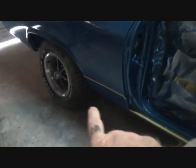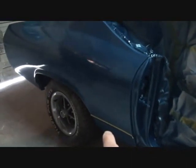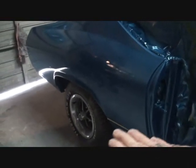Now that we got the car painted we went ahead and pulled some of the parts in here. We've got the fenders, the doors, and the cowl paneling, and we're going to go ahead and paint those. We went ahead and sanded those down to 600 and went through the same procedure that we used on the vehicle itself. First we're going to apply our epoxy primer, and while I'm doing that, 972 is going to be color sanding the bottom of the vehicle — the rocker panels and below the reveal section, and of course the back part as well.